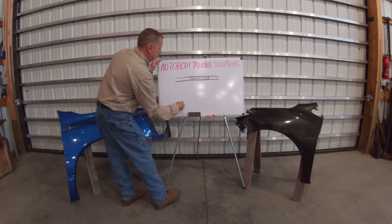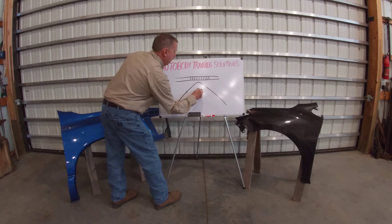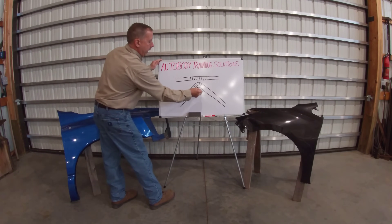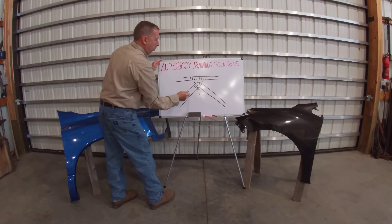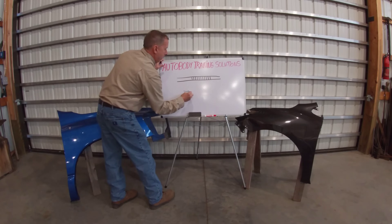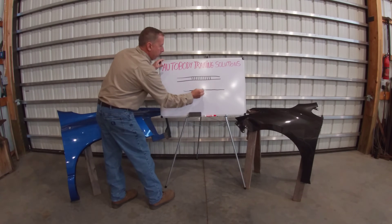What happens when you take that piece of metal that's been in a collision — now we have a bend in it — so what structure was nice and even before is now going to be distorted. This area is going to be compressed, that's under pressure. This area up on the top here is actually getting stretched. So when you go and try to straighten this piece of sheet metal and flatten it out, you're going to end up right where that bend was with a little hump. That area right there is work hardened from being bent.